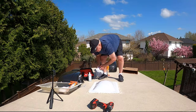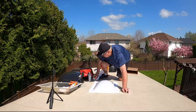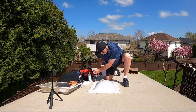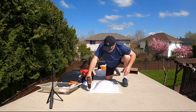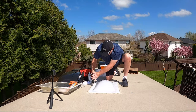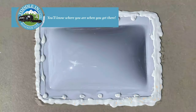Skylight safely secured to the roof, and I've got it screwed down. The only thing I forgot to mention was that the screw holes on the new one did not align with the original ones, so I carefully sealed the original ones with lots of caulking, set it down, centered it, looked at it, screwed it down, and then poured all kinds of caulking all around.